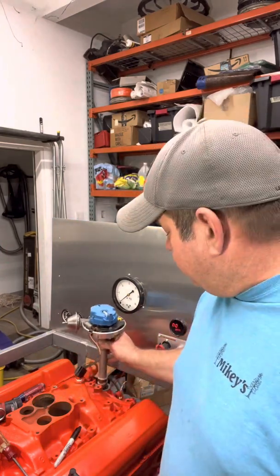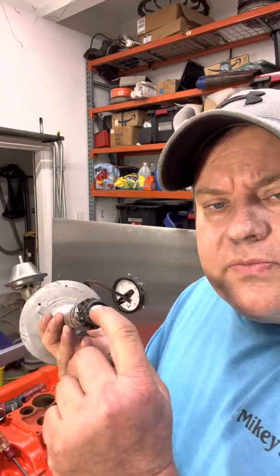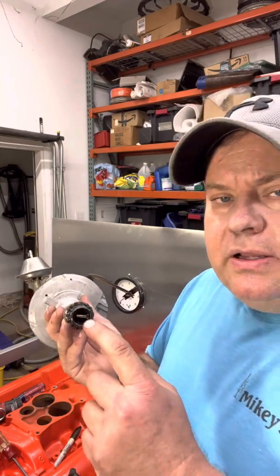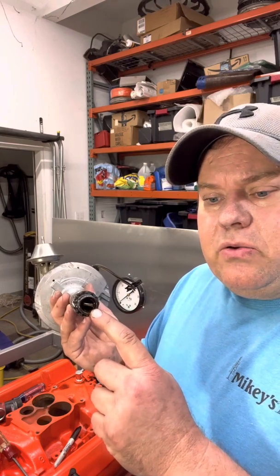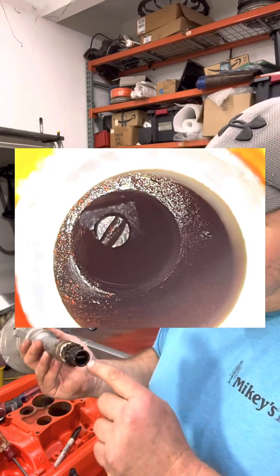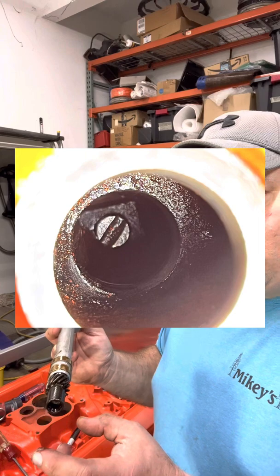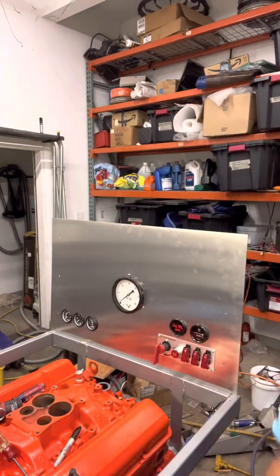Also on the bottom of this gear, there's a square piece of metal that runs across it. That piece of metal goes into the oil pump drive shaft rod. If you look down the hole, there is a drive shaft that has a notch in it, so we've got to get that lined up. We can turn that drive shaft with a screwdriver.